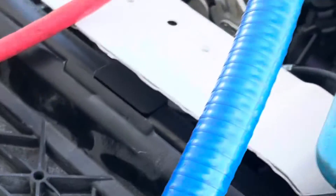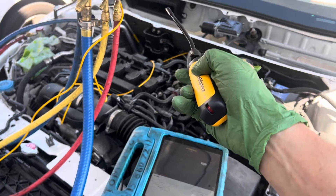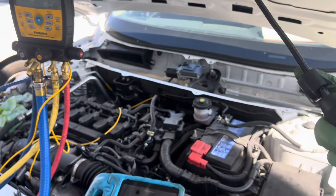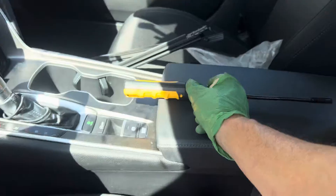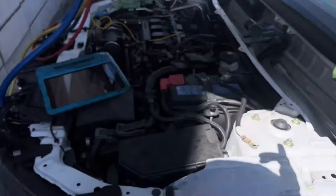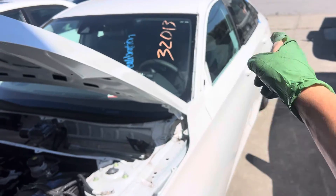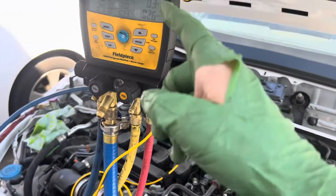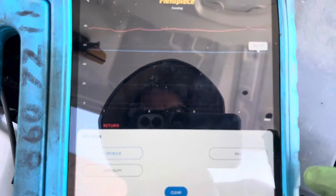Let's put it on fresh air and look at the temperature going into the evaporator. Right now it's recycling air — let's see what the inside air temperature is. We're just going to take the cabin air temperature. This is the load on the evaporator. Even though it's been sitting out here since this morning under full sun and it's a black interior, I just started this with only 230 grams, with a discharge temperature of 55 degrees.